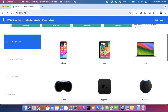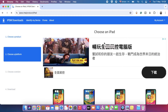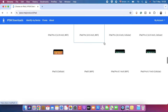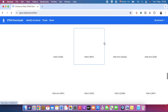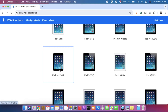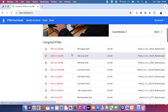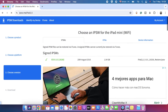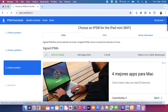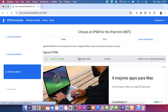Next, we're going to scroll down and select our Apple device model. In our case, we've got an iPad, so we'll tap on iPad first, then scroll down to find our specific iPad device. In my case, my iPad is an iPad mini Wi-Fi. Once you tap on your device, you'll see a list of software versions. You want to make sure you download the latest version, which has a green tick. I'll tap once on the operating system.